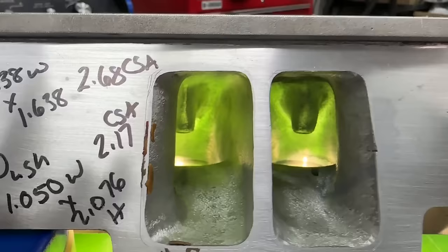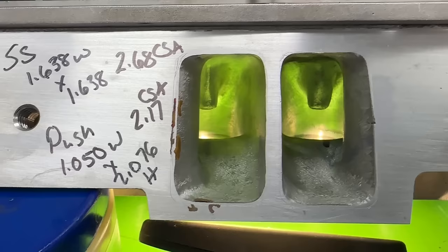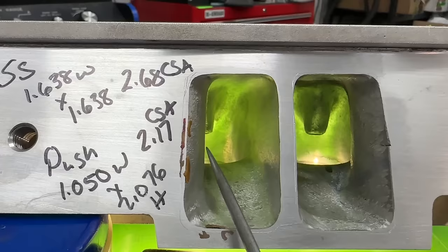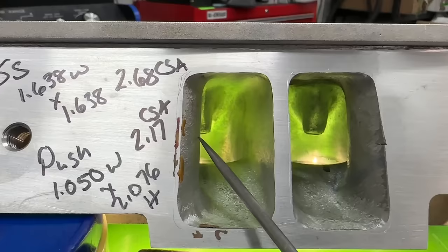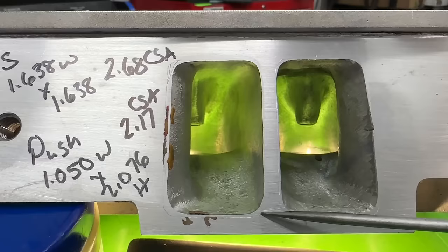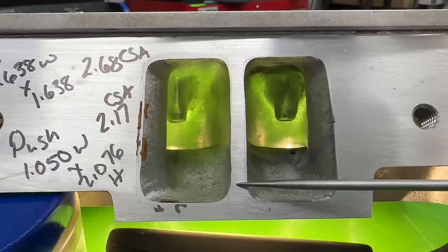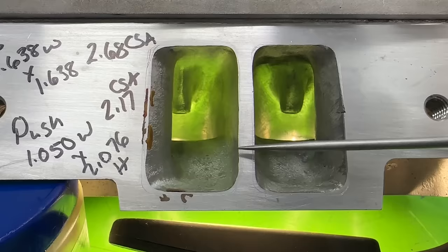So the push rod slot is small. What would I do? The thing is it's tough - you only have so much room between the push rod and the wall. I didn't measure how thick the wall is here, but I think you're about as far as you can go on that side. One thing you can do, at least width-wise, is you can make this divider smaller here. I probably would have taken about another 30 thousandths out on each side. You still would have had enough to clamp the gasket for sure. That would have made 2.080 square inches, which would give you a little bit more.